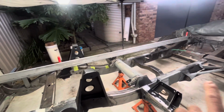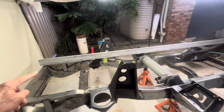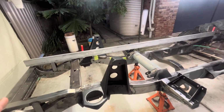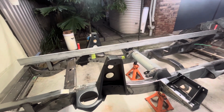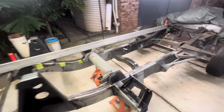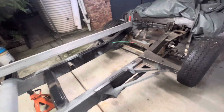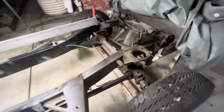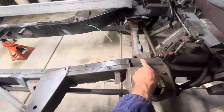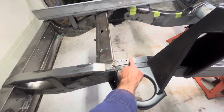Now with the horizontal datum line, which they refer to as B in their drawing, you'll see a B written on one end and a B written on the other end, and that's in drafting, architectural stuff, that's BB. There's no written description or accurate detailing of what the two reference points are, because I say two because in the drawing it's touching 2 points. My interpretation is it is off the highest points of the chassis at the axles. So front axle, the curved chassis, find the highest point there where a straight edge would touch, and then same with the rear axle. You've still got a little bit of curvature there, find the highest point.